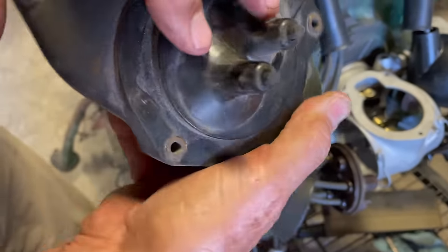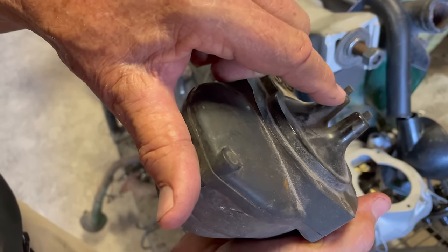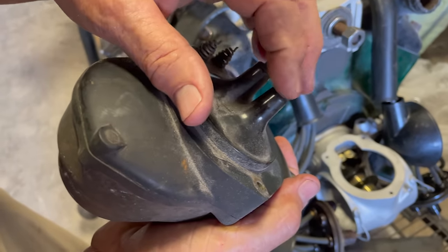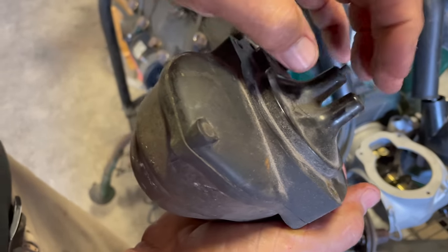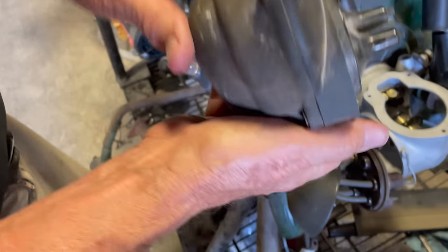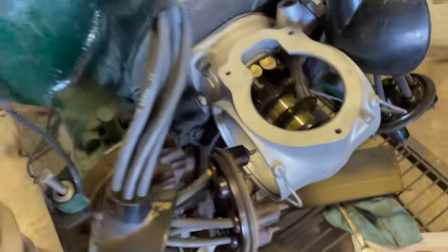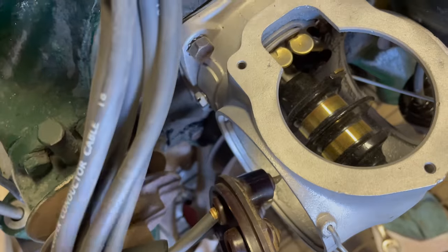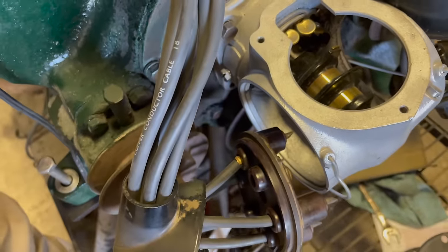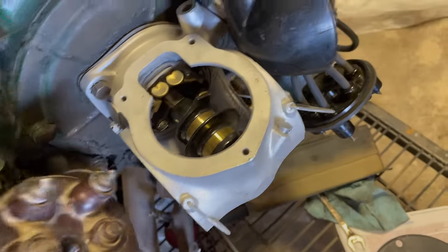That's the way it relates. And of course, these points need to be in good shape, and flat, and be able to compress and come back out. Now this one is kind of draggy. That's what sits on top of that and rides in these two spools. So those are the electrical contacts that ride along, and that sends a message to the 12 cylinders via this.